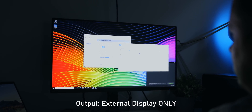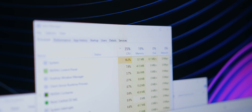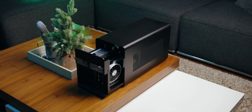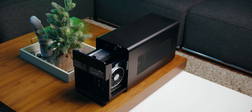One issue that happened more often than not was stuttering in Windows and massive CPU usage when moving around Windows or even when in a game. The only way I found to get around that was to disable the Ice Lake GPU. There were also some random crashes and Windows would freeze, and the only fix was a power cycle. This doesn't seem to be a Thunderbolt issue with the Stealth or Core X — it's really an inherent Windows issue where devices aren't talking to each other. Hopefully Windows 1909 will clean that up, but right now it's usable if you're aware of these hiccups with Ice Lake and the Core X.